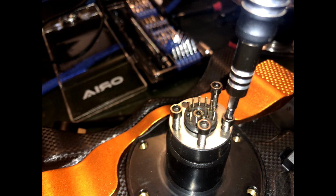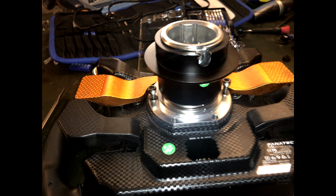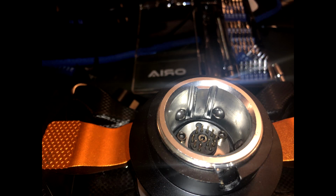Next, the metal plate and the 4 3mm Allen bolts. This is the part which ensures that it can only go on in the correct orientation. Now you can secure the QR back on, and if you had to dismantle the QR because it was the only way to get the Allen key on, then have fun making all the ball bearings stay in the right place whilst you refit the spring, collar and snap ring.